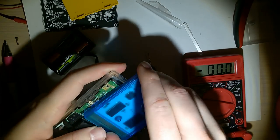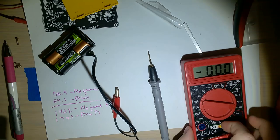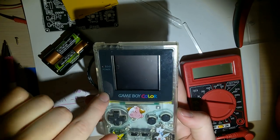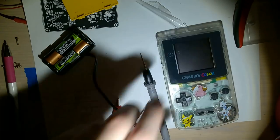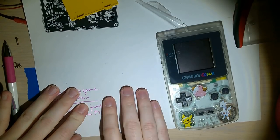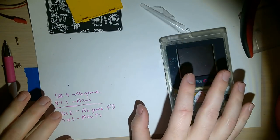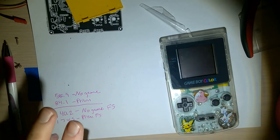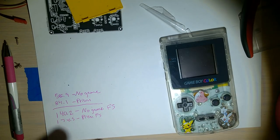They were discussing the issue, and it was when the screen kind of whites out, because there's these two black bars at the top and the bottom. When the screen whites out like that and those black bars go white, what's happening is one of two things. One, the frame itself was interrupted, or two, the Game Boy is essentially experiencing a brownout. So I'm gonna get my scrap paper here, fiddle on this.